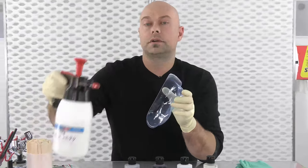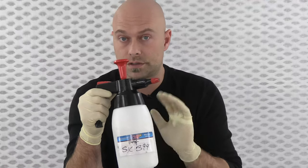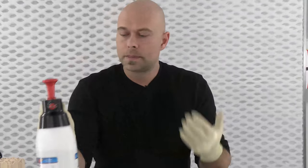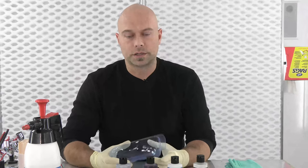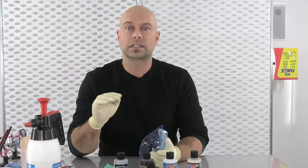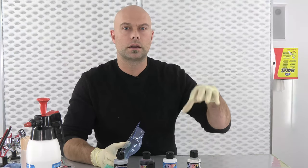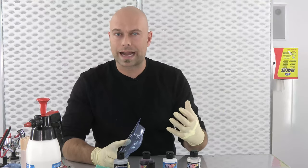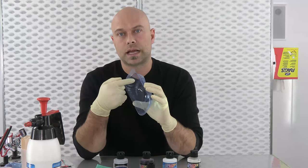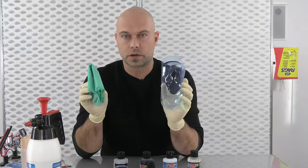In this particular case we use a water-based pre-cleaner from PPG — it's SX394 — this is another great option. But if you don't have access to this, a mild dish soap and water is gonna do the trick. Dry that with a lint-free towel. If you are gonna use a tack rag, make sure these are specifically for water-based paint systems — they're wax free. Tack rags from big box stores often have wax or glue on them that can transfer onto the plastic and you will see that, so use something more paint-specific.